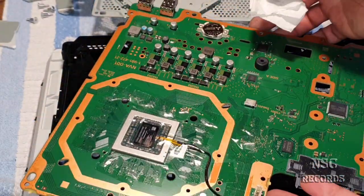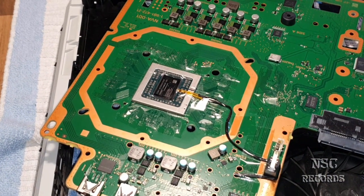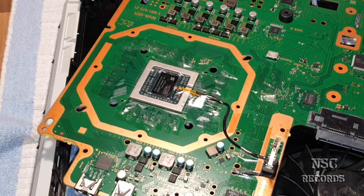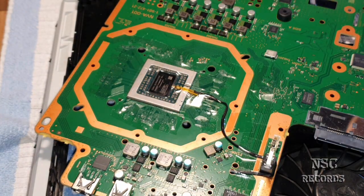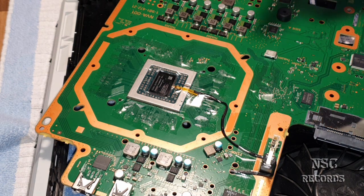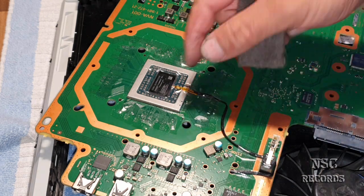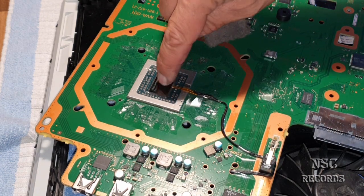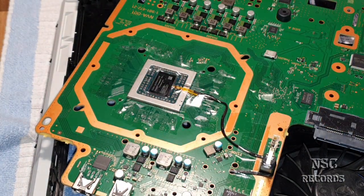I think I am going to test nearly all thermal pastes on my PlayStation 4. I still got one at home that I have not tested yet. Let's try again with IPA to clean this all the way - should be the same. You don't need to use sandpaper here - as long as you can clean it with your fingers and your fingernail, your fingernail will not destroy the APU or CPU, but sandpaper is going to scratch it a little bit.